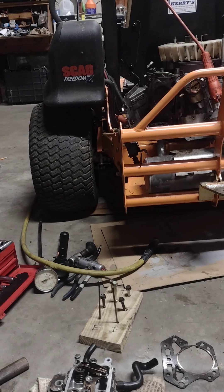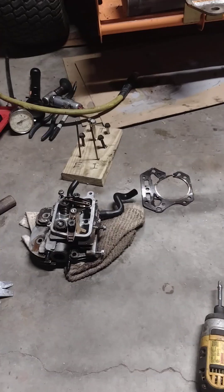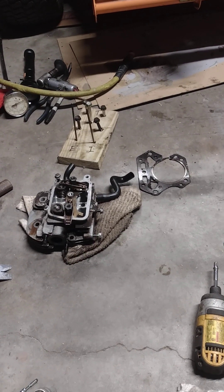The neighborhood's fogged out right now — there's not going to be a mosquito problem. So I did a compression check and it was normal on number two, but number one was only 30 psi. Plus when you started it you could hear the head gasket leaking, so I drove it up on one cylinder, just pulled the plug wire off and disassembled it.